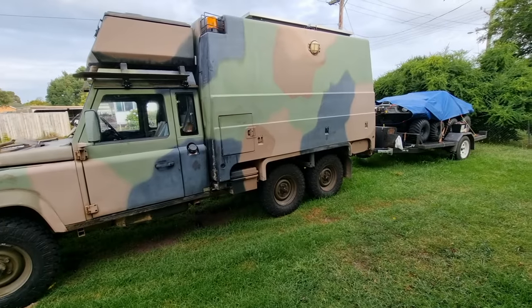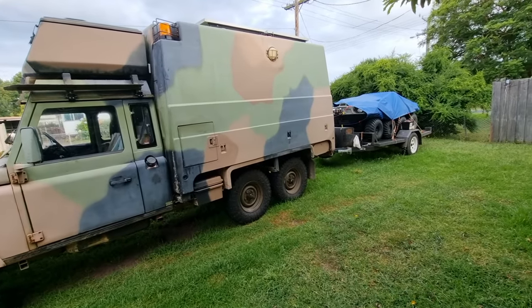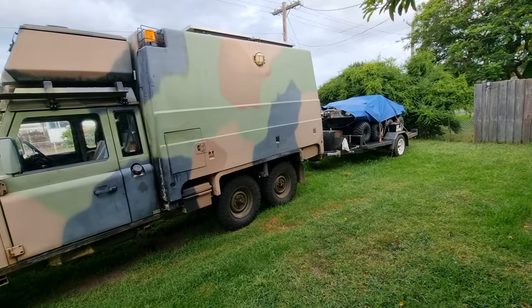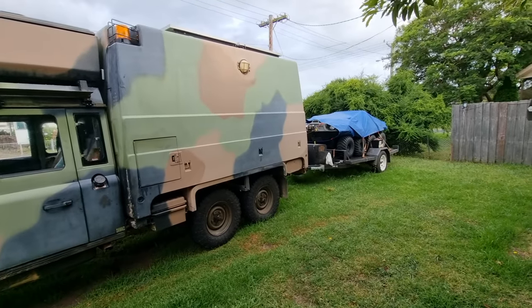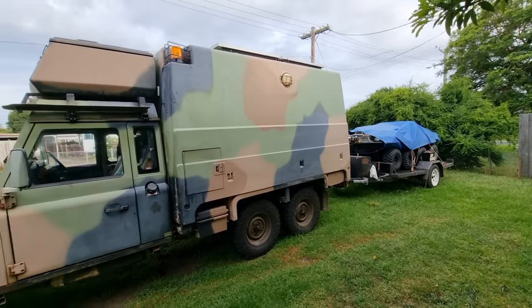Well, today's the day. I took this thing for a dip several weeks ago and forgot to grease the outer bearings. And then I took it for a trip just recently in brackish water, and so I really have to oil them bearings, or grease them. Especially considering they'd been running for quite a while and were kind of hot, so backing it in they will have sucked some brackish water into them.